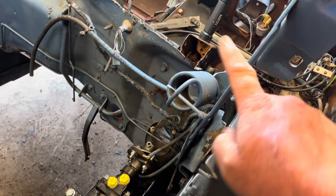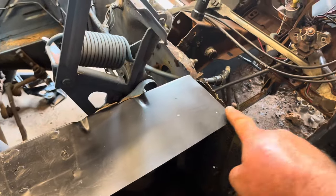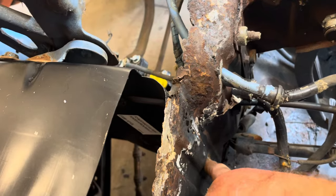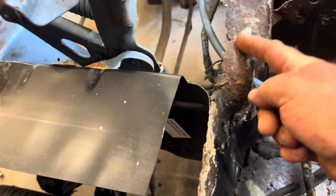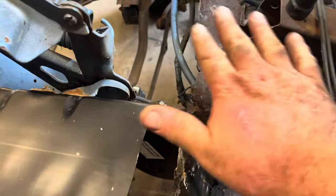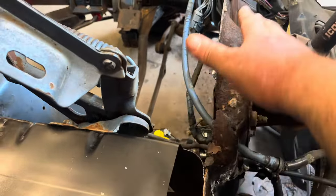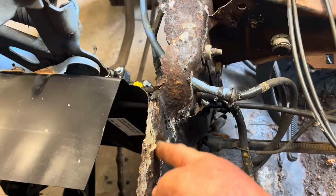That's why all of this happened right here. Now I'm not completely done — I've got to trim this off and there's some rust right here I've got to deal with. I welded from here down because I'm going to have to come in and put a plate or something in here and then fix this up. It's going to take a little work, but once I get this fixed and I put the cowl on, nobody will ever see this again. This is really no man's land right here. I plan on welding into all of this over here on the side and making it look a lot better.